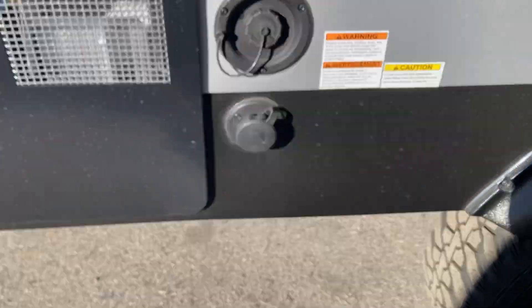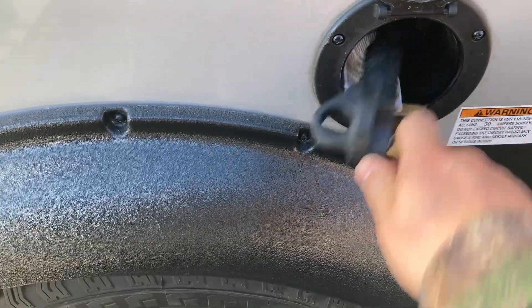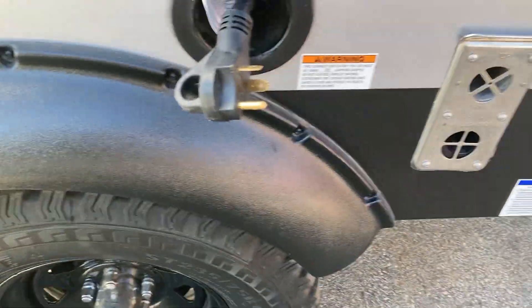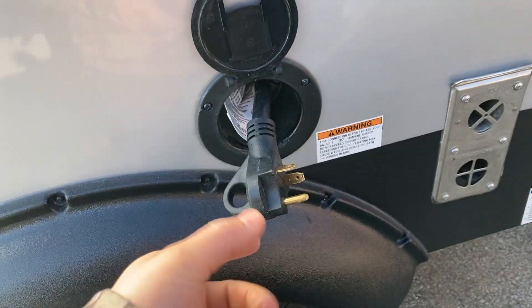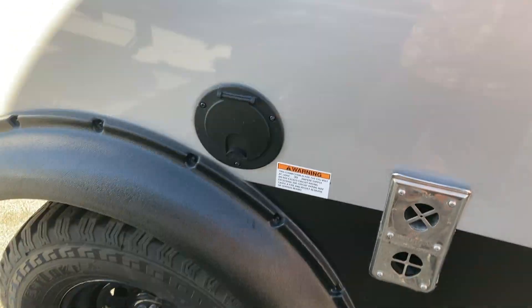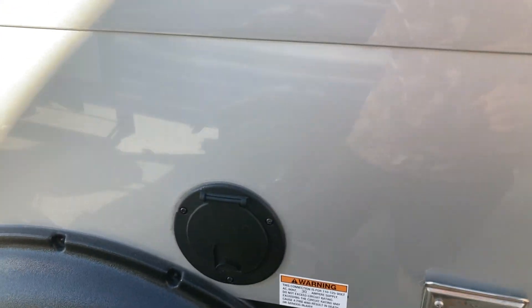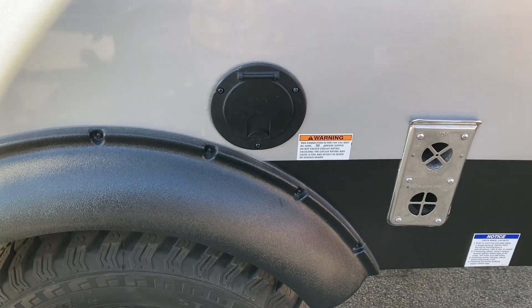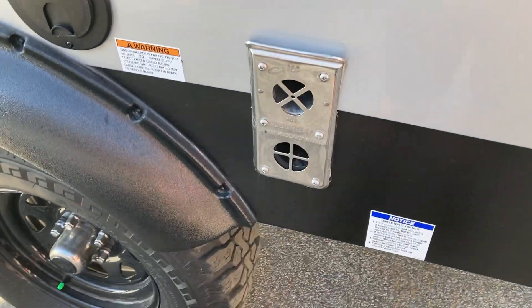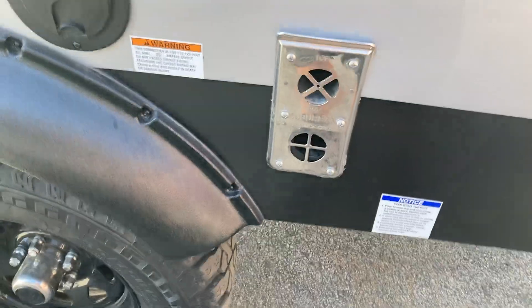On the bottom is a city water connection — that's for when you're at a campground and it gives you water directly to your sink. Right here is where your power cord is stored. It just pulls out and it's usually around 25 to 30 feet long, so it's plenty of length for any campground. This is a 30-amp unit, so when you're at home you can plug into an adapter to plug into your house or an extension cord. The only thing you can't run at home is the air conditioner because it requires that 30-amp circuit, but you can run everything else, charge your battery, and get your fridge cold. Next to it is the exhaust for your furnace — make sure nothing's in the way of that, and don't touch it while using it because it gets pretty hot.